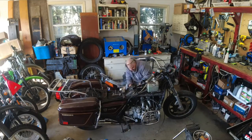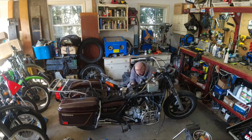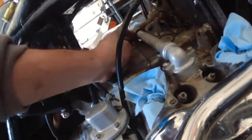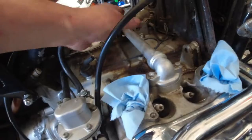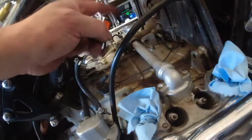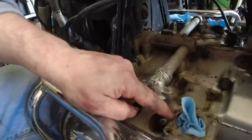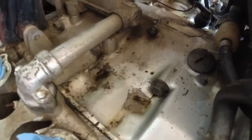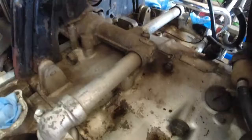That was hard — carbs coming out that hard. I'll explain what happened. Your problem is these pipes right here — these coolant pipes — because the carb bottoms want to hit them. And then you're limited by this ridge right here in the fuel tank. That's why they can't come out this way; they have to go that way. Those O-rings just get crushed and they'll cause a vacuum leak. That surface is pretty dirty so it'll all need to be cleaned up. You can see these puddles — that would be gas leaking out, and over here the same thing.